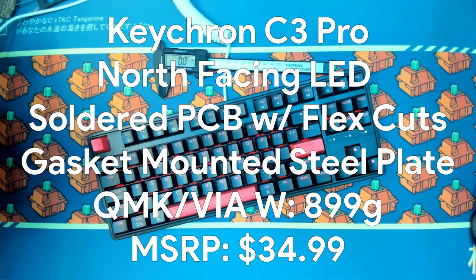Just the specs. Today we're taking a look at the Keychron C3 Pro, an Amazon exclusive Keychron pre-built. This keyboard MSRP is $34.99 and comes with QMK and VIA preloaded. It is a north-facing, non-hot swap keyboard with red LED single color and flex cuts. It is available with both brown and red Keychron switches, and includes a gasket mounted steel plate. This keyboard comes weighing in at 899 grams.